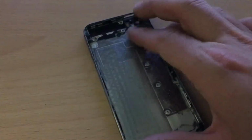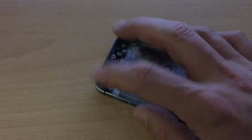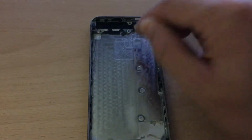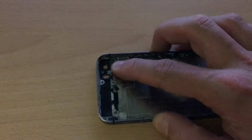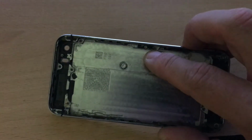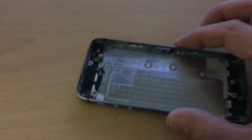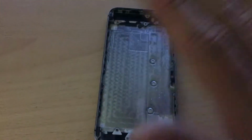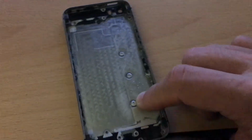Don't forget your buttons, your silent switch, your vibration motor, your motherboard. Your bracket will fit here because the motherboard will be held down with this screw and this screw. This one right here. That's enough to keep the motherboard in place, and it's going nowhere, trust me. It's not flapping around, it sits perfectly fine. But you have to sand down these 3 posts.